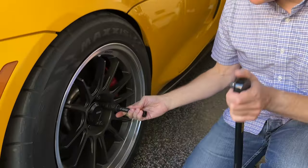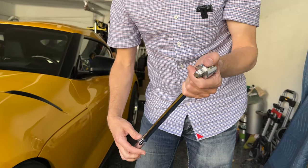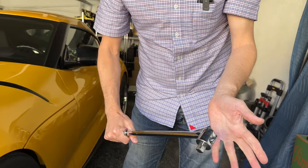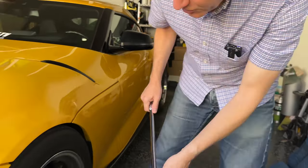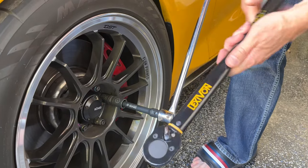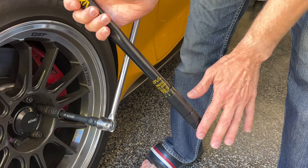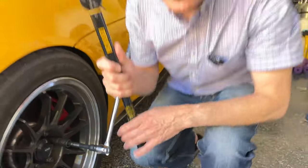Another thing you want to do is maintain your torque wrench properly. People ask, should I use this to loosen up the wheels? You certainly can in a pinch, but really what you should do is get a breaker bar like this — it's pretty cheap, around $15–20. There's no gearing, there's nothing to break. Using a torque wrench to loosen up the bolts causes the spring inside, which is calibrated to a very fine value, to go out of whack. The torque value you're setting could be way off — you might say you've set it to 95 foot pounds, when in reality it's only 80, and that's bad.